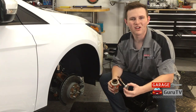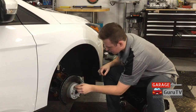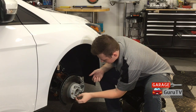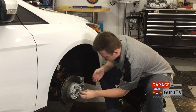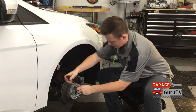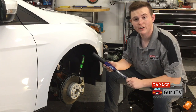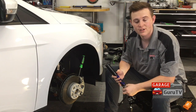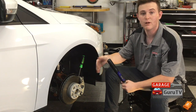The spacers are ready to install. For our 2018 Ford Focus SEL project vehicle, we decided to use the 20mm spacers in the front and the 25mm spacers in the rear. When paired with the H&R Sportline lowering springs that we will be installing in the next episode of GarageGuru TV, we will achieve a perfectly flushed fitment with the stock 17x7 inch Ford wheels. Once you have the nuts for the wheel spacers all snugged up, grab your torque wrench and tighten them down to your factory lug nut torque spec — in our case, 90 foot-pounds. I put a screwdriver in one of the brake rotor vents in order to stop it from spinning when torquing it down.